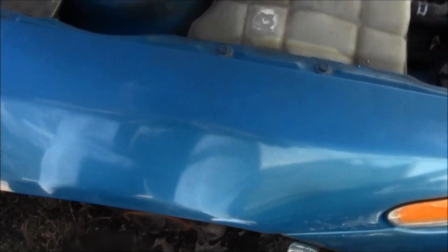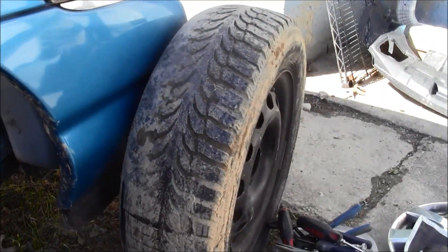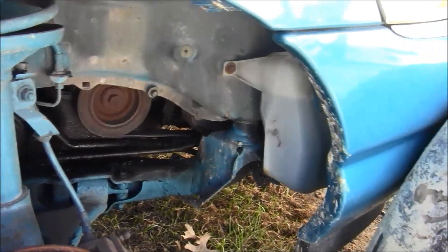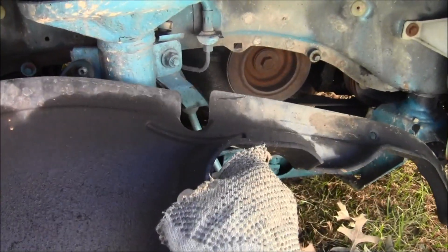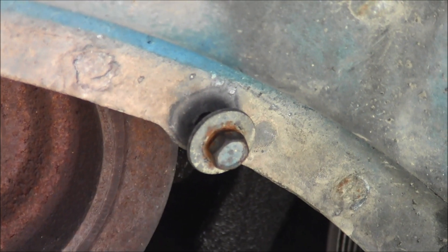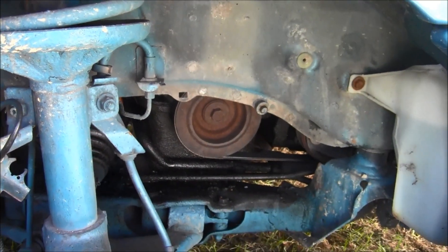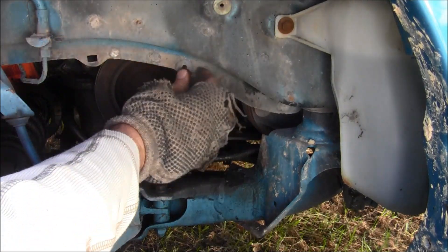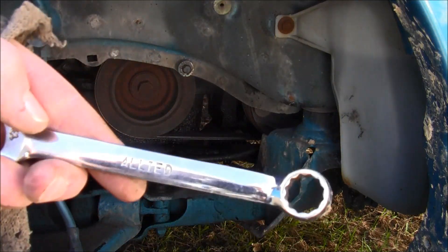Let's go below. What you need to do is remove your wheel - you don't have to, you can do this without removing the wheel. But I removed that and then I took that bottom cover off. That bottom cover looks like this. Take that out, it's just a 10 millimeter bolt. There's a screw hanging in there and then there's the other one. You take that cover off and it's up underneath there, and it's a 13 millimeter.